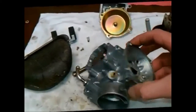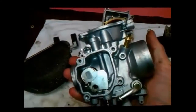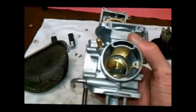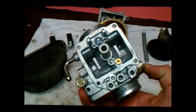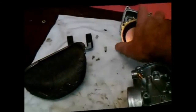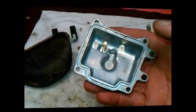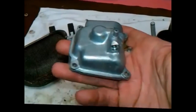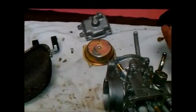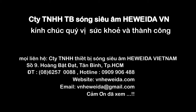Here we are all completely cleaned and rinsed. How does that look? Does that look a lot different? That's that same carburetor you were just looking at. That's one trip through an ultrasonic machine, and I will guarantee you the inside of that carburetor — every single passageway there is — is just as clean as what you see there. There's the carburetor cap, turned out great. How about the float bowl? Clean as a pin, looks darn near like brand new. And that one didn't go through so I'll hand clean that.